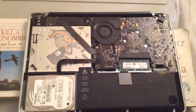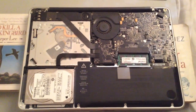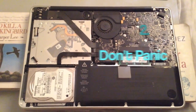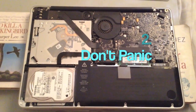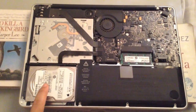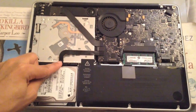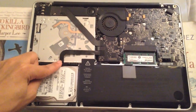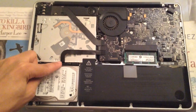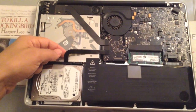Once you've got them loose, you want to make sure that you don't lose them. Your computer is probably not messed up. There's probably just one issue, which is that your hard drive is not being fed to your computer, and the problem is usually this cable here. This cable will bend and wear off, and the heat will just kind of wear and tear the cable.